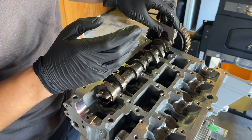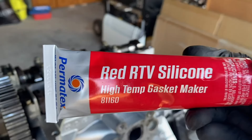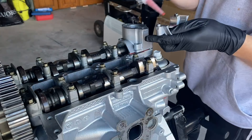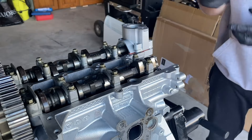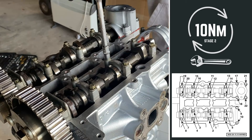I'm running down all the bolts finger tight for now. The two end caps at the gearbox end need to be sealed to the cylinder head — Ford specifies a particular sealant for this but it was a ridiculous price, so I'm using some red RTV from Amazon, though the tube made a complete mess. I'll leave the Ford-recommended sealant part number in the description. The manual says to tighten all the bearing cap bolts two turns in the specified order, then torque each bolt in the same order to 10 Nm.